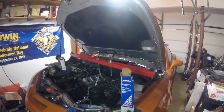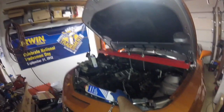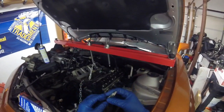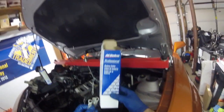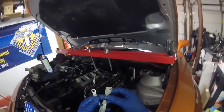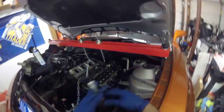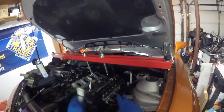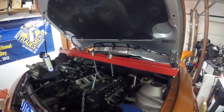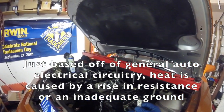The first thing is adding a ground to your car. I ordered a universal ground strap — it's an AC Delco and it already has the ends on it. I'm going to take an extra ground from the engine to the chassis, going from here and grounding it to here. Some people say the ground isn't very sufficient when it gets hot, so adding an extra ground might alleviate that problem.